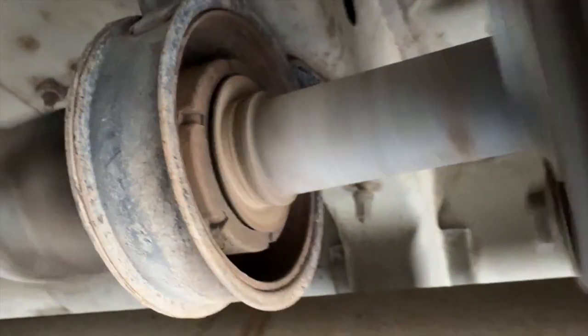I've just had a call to say that my landlord's Freelander is making a horrendous noise — can I have a look? So I'll insert the video. It looks like one of the prop donuts is gone. So I'm just going to whip the prop off just so he can still use it for now, and then chances are he probably won't put it back on. But if he wants to fix it, he can. So let's get this prop off.